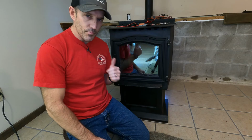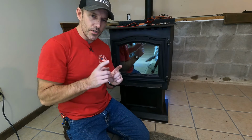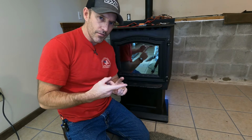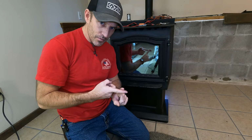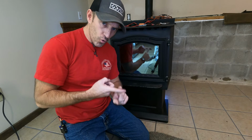All right, your 3 blink status. If that status light is blinking 3 times, that could be your ESP probe. If you've never cleaned your exhaust, that definitely could be the problem. So either your ESP probe, you're going to need a new one.